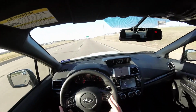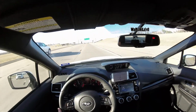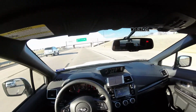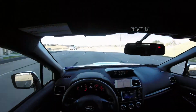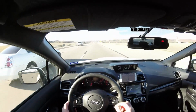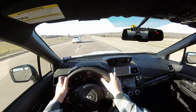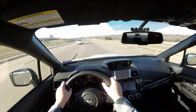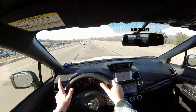When you're sitting at a red light, it's best to not have your car in first gear holding your clutch in the whole time. Just wait until the light turns green or until it's right about to, then press in your clutch and put it in gear. That's really your best bet, because holding it in will wear out your throwout bearing a little early. It'll have premature wear. That's not a good thing. You're not gonna have a good time, okay?